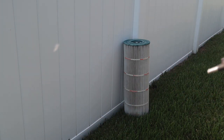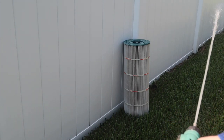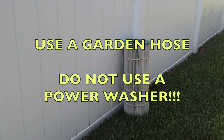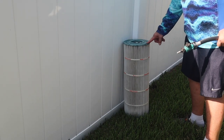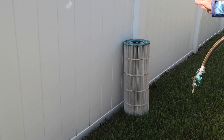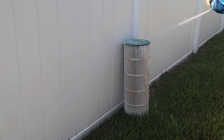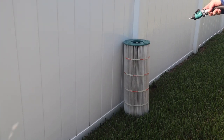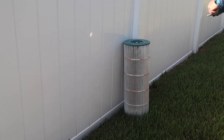This nozzle is just an on-off but it has what looks like a little fire hose — it produces a real fine stream for a long way, high pressure. Remember the PA120 marked on top — I put it there as a reference to know where I started. I'm going to wash one quarter of the side all the way down, working my way from the top to the bottom. You can see on camera where the brownish is turning white again where I get the dirt off.